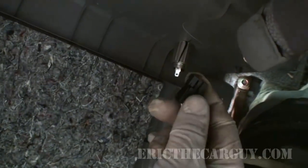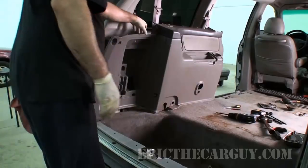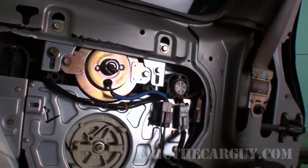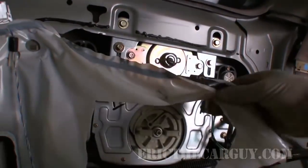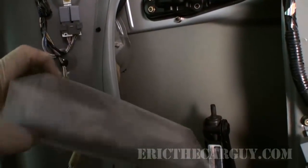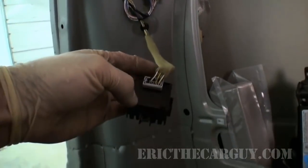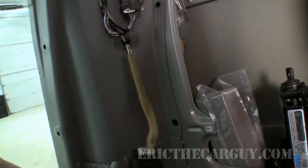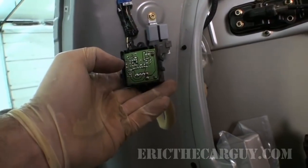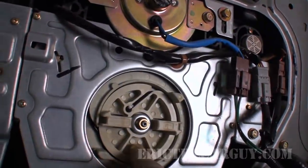Remember that electrical connector I warned you about? There it is. There's a little release on the side — it might be in a different position on yours. Pull that out. In a way, we've found our prize. Normally this vapor barrier is up like this, but it came loose on this one. Interestingly, they put a bag of foam down in here — probably just for sound deadening. These are also important grounds for this whole assembly, which I was looking at in the service bulletin. These are also the relays, this is the beeper, this is where you adjust the tension.